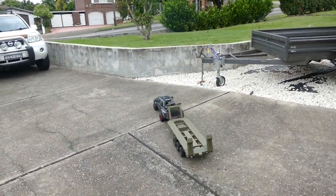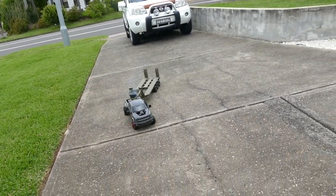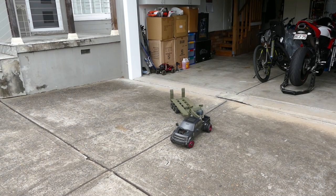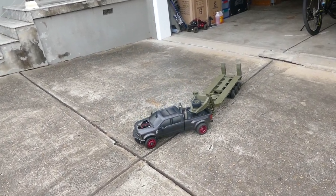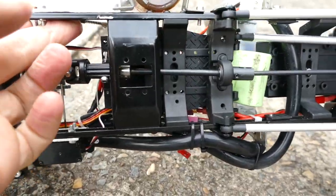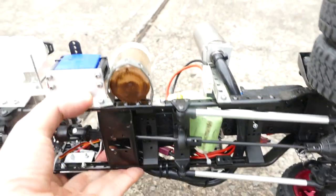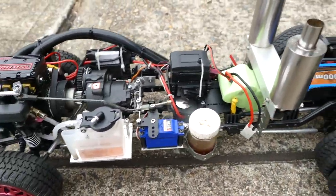I think that clutch needs replacing after this. Bear in mind that that is 10 kilos, a trailer alone. It's slipping. Under further inspection, I have two grub screws holding in this drive shaft and one of the grub screws just came out. I'll put a new one in there and hook her back up again and see how she goes.